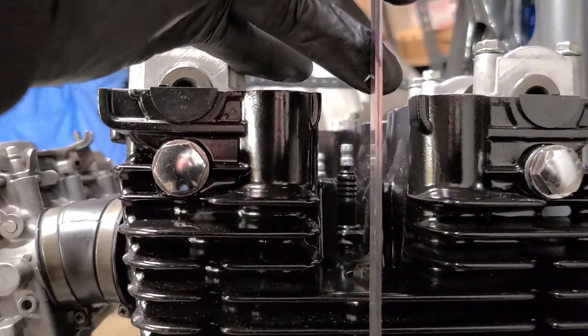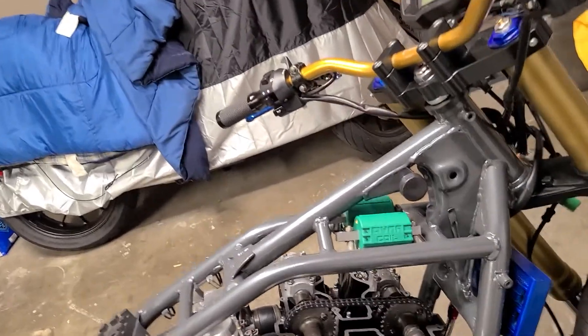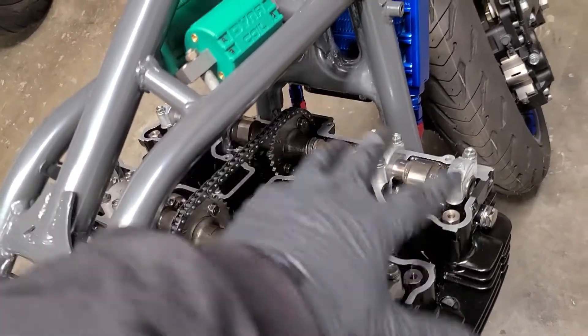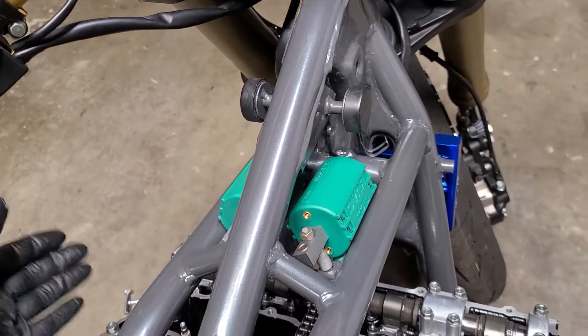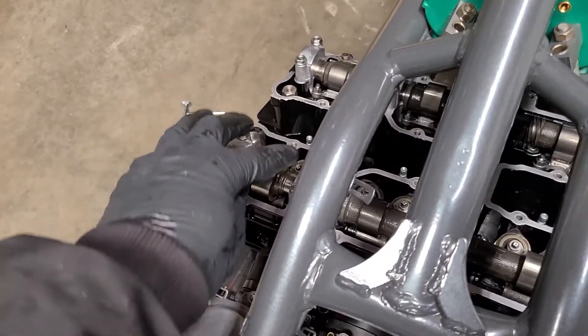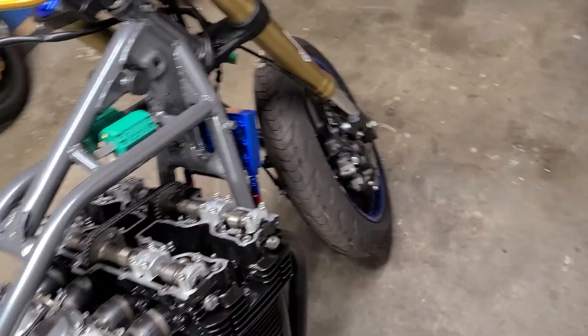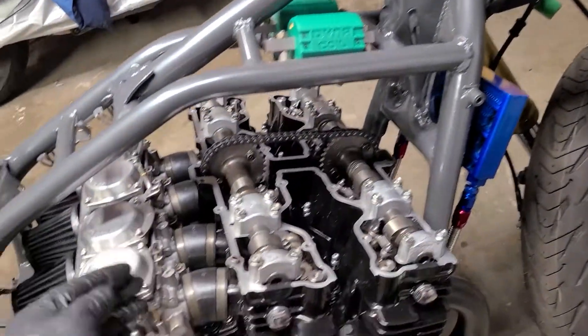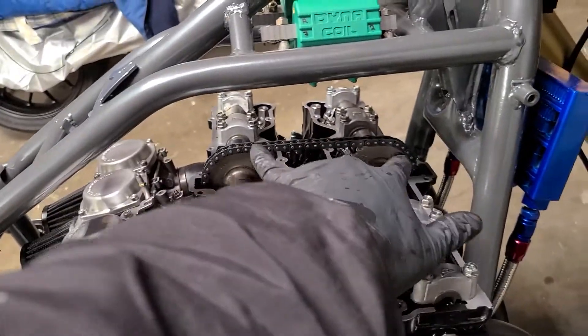To the spark plug and to your number one and number four — this is straight up and down. Once you've done that, you've got the chain on, the cams on, and your cam caps on, and they've been all tightened down. You want to tighten those down equally using a cross pattern — one, two, three, four, five, six, seven, eight. Get the cam caps on there, tighten it down, get your cam chain tensioner in there, make sure you've counted the links and the chain's taut. The arrows are facing straight up, and these two notches right here are facing each other.